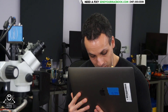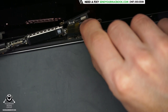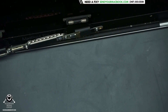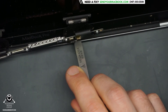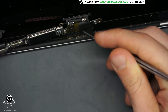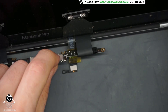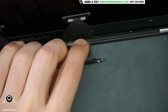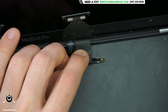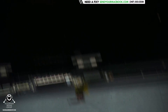And this seems like something that is really avoidable by not having this design that results in all of the dust getting to this one part. But more importantly, the serious issue — even if you did have dust going to this one part — is having this cable with nothing really reinforcing it over here. That means when dust does get in that area, it is going to puncture and destroy this, because as you move your computer back and forth, when you open it more, you are putting force on this, which is then going to push this against here as you move it. So the weight of the display assembly is actually pushing that little piece of dust into the cable and ripping it apart.